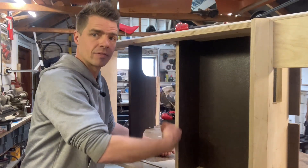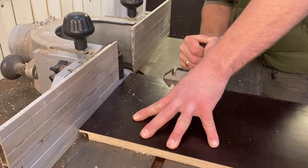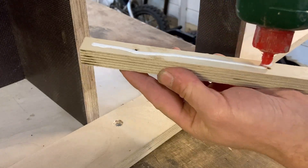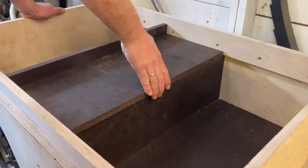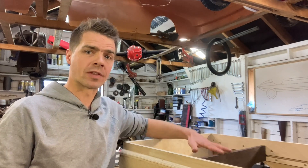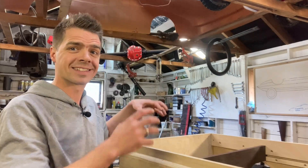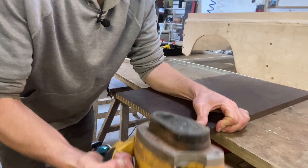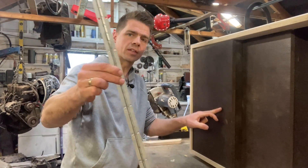The next thing I need is a seat cover to go here — not only does this form the seat itself but it's also the top of the battery tray. I need a similar cover on the other side too: this will be like the seat base except it will hinge up from the front to give access to the motor, the differential, and lots of electrical components. It will also provide a seating area for taller children and adults who want to drive the car. It's going to attach with this piano hinge.